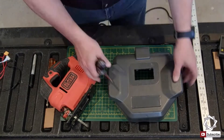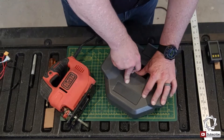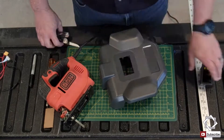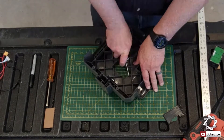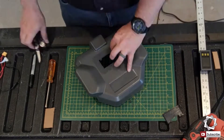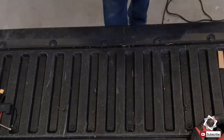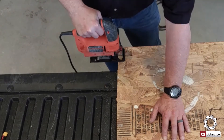When I get to the lights, you'll see that there are two units, two headlamps. The headlights I got have a voltage range of like 12 volts to 70 volts — just a really wide range — so they can handle all sorts of different voltages. Most of the stuff I saw on Amazon or eBay was around 12 or 24 volt lights, and that means I would have to step down. I was looking at DC-DC voltage converters to step down the voltage, but I just opted for these lights. It was less money to get the lights with the wider voltage range, and they work out really well.